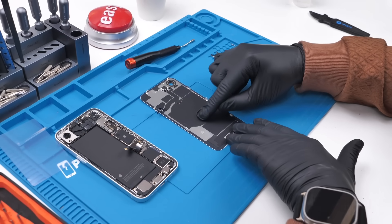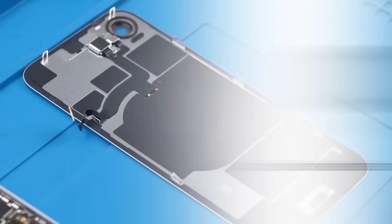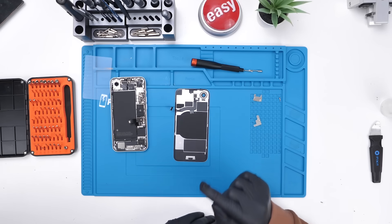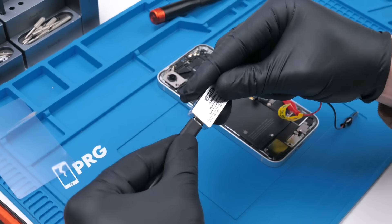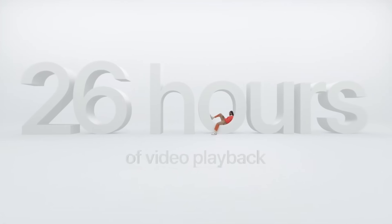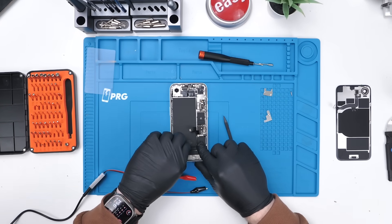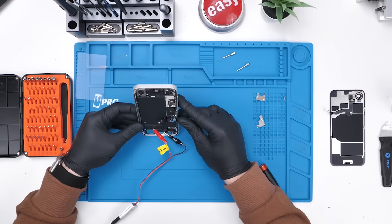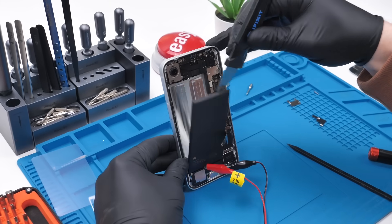It's good to have removable back glass because it makes the device more repairable. On the back glass, we have the wireless charging coil, which is now 7.5 watts — a bit of a downgrade, and wireless charging will be painfully slow with this device. But I still want to see if we can add the MagSafe magnets. For now, let's take a look at the battery. The battery life on this phone is really good, partly because of the new C1 chip, but we still don't know how many milliamp hours this battery is. We're going to use this tool which runs a current through the electrically activated adhesive and the battery should come right off — just like that.